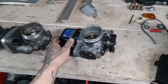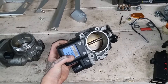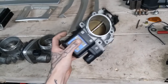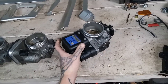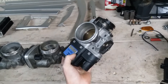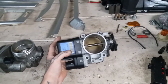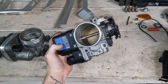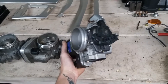Let's now discuss throttle bodies. Here is your only option if you are a 323, 328, or MS-42 E46 — this is your only usable throttle body. This is a hybrid which utilizes both drive-by cable and drive-by wire. There are three cons and one pro. The first con is the size — it's pretty big. Second con is the weight — it's actually a pretty heavy throttle body, easily around three and a half pounds. The third and biggest con is that right now in the United States, this throttle body brand new is over a thousand US dollars, which is insane. The only pro for me is that being drive-by cable, I like having that manual feeling with my foot — it makes for nice feedback.